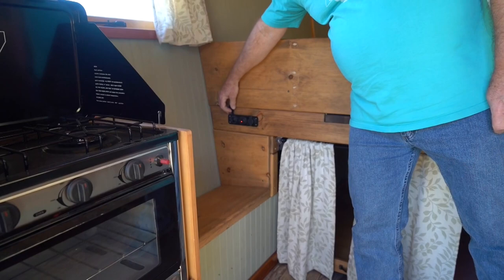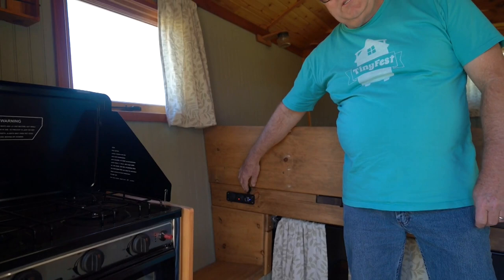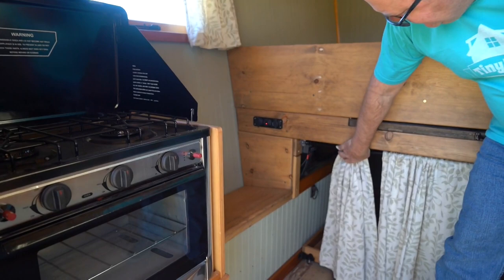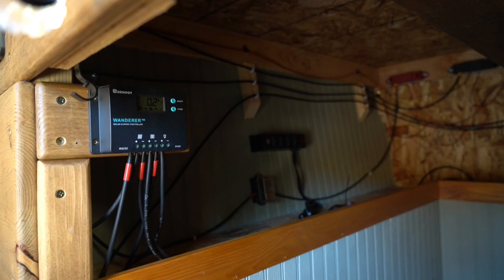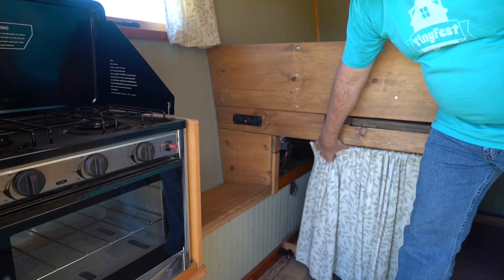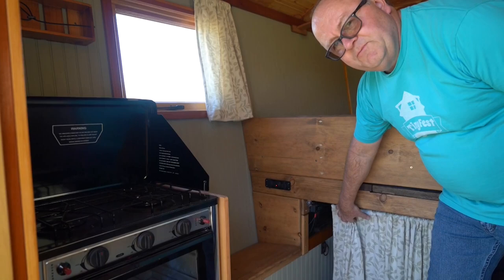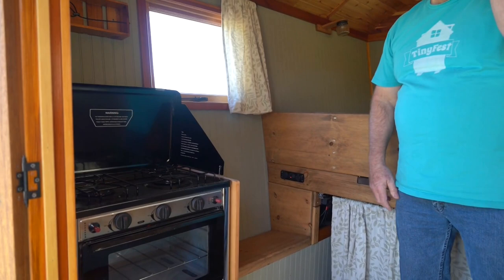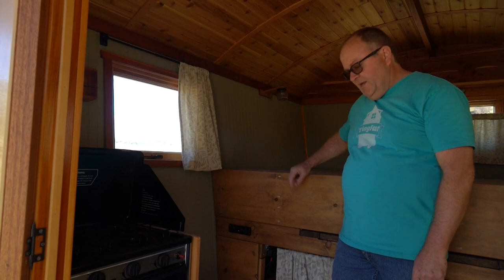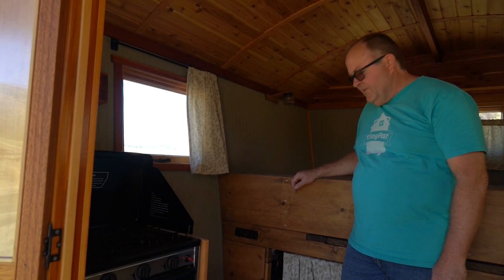For power, there's a unit with a standard 12-volt car charger and two USB ports at five volts, two amps. The solar charger underneath provides another two USB ports, and the power strip adds another two, so you've got plenty of USB power. You can run off-grid or plug in at a campsite. The solar panel connects to a battery up front in the same box as the water storage, keeping everything out of the way with no fumes inside the trailer.